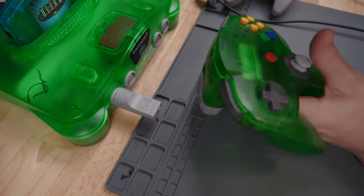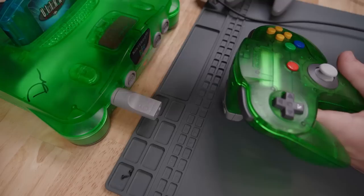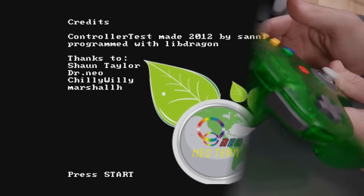This is pretty much the same process for pairing the Nintendo Switch Online controller. One thing that is kind of annoying — and this is probably a Blue Retro thing, not a problem with the controller — is that after the controller is successfully paired, if you turn the console off and back on again, the Blue Retro adapter will forget about the controller and you'll have to pair it all over again.